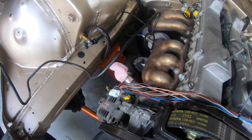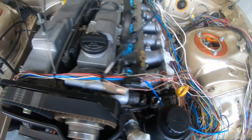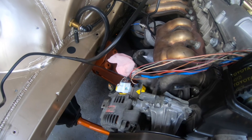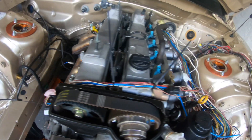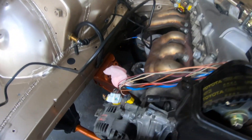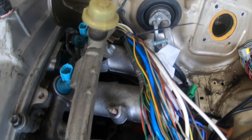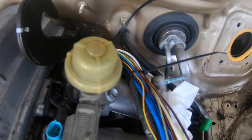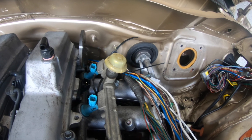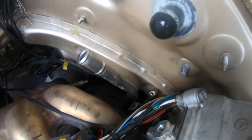Since the wires are all in one body, I had to go one by one — each plug, de-pin it, loosen it, and remove it from the mess so I can separate it and make it easier to run. Same thing on the other side — some of that wiring also goes to the back of the motor, and I'm leaving that alone for now. Once I put the car on jack stands, I'll look more into tucking that. All the plugs that went this way, I ran them all the way to the back.